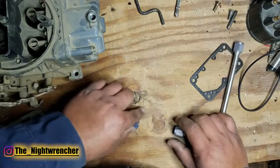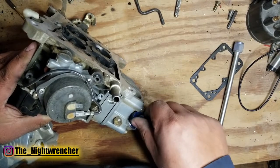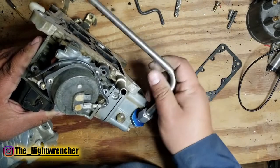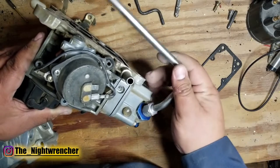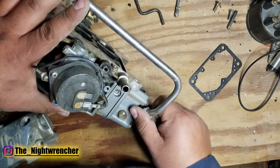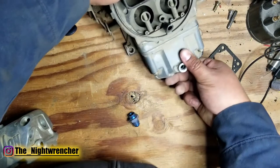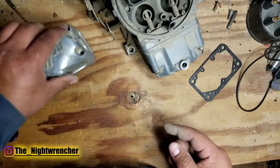These AN adapters take the place of the standard chrome off-the-shelf adapters — use the same gasket and install them in place. Sometimes you need to clearance them so they fit certain fuel bowls. Once installed and tightened properly with a 17mm or 11/16-inch wrench, install loosely on both sides then tighten up, and you will never have a leak on these carburetors again. You can get these adapters in standard Holley sizes and even smaller Demon sizes. That's about it — hope this helps, I'll see you guys in the next one. Night Wrencher out.